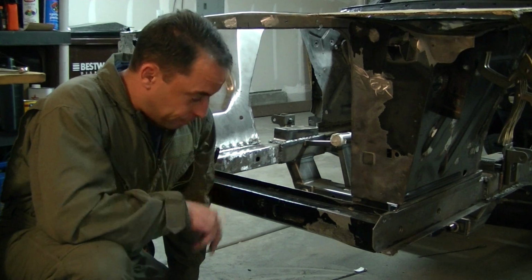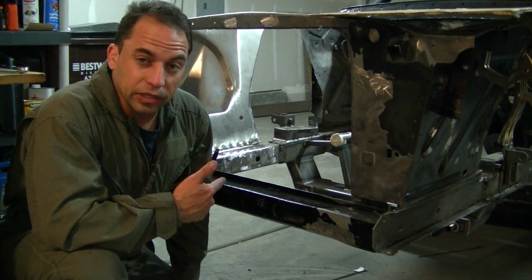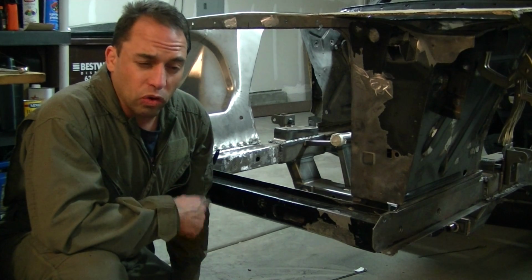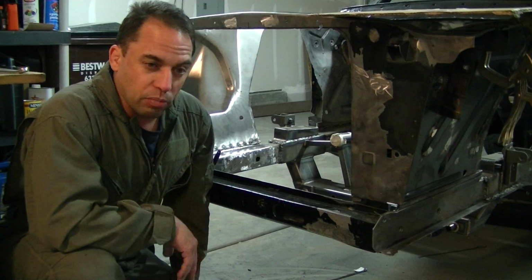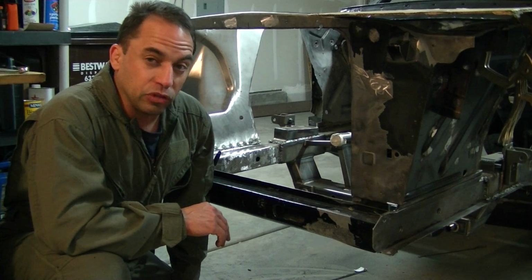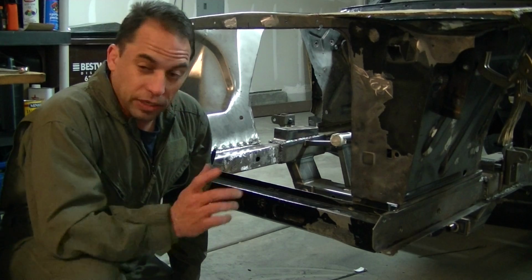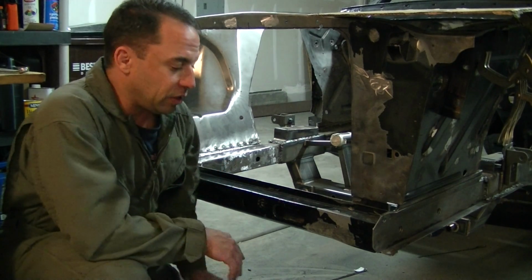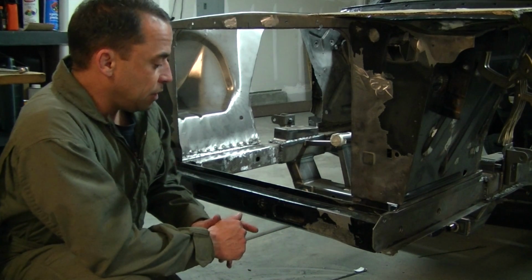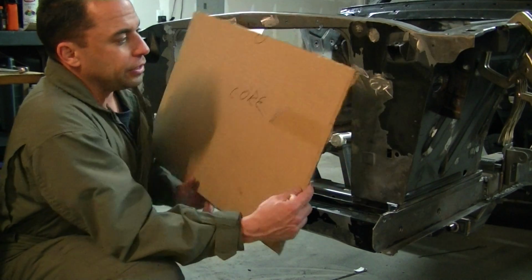But anyway, I wanted a bigger radiator because, first off, it's more efficient. It's a cross flow, and I'm putting a larger displacement motor in here, so I need all the cooling I can get. The stock one in here was a 2-core, and then I put in a brass 4-core, and it just barely cooled the 302 that I had in there before. So with that radiator, I think it'll be more efficient and keep the engine cool.